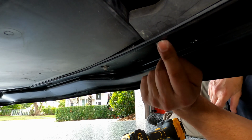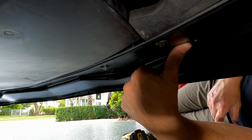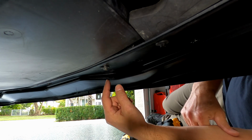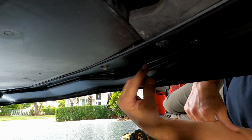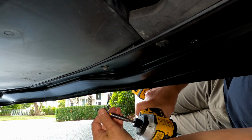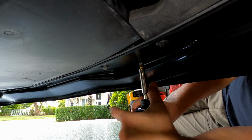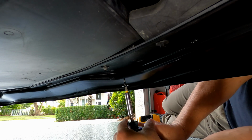Alright guys, so some of these have a little nut behind it that goes on these plastics, but these in the front don't. So this is where I think some of the rivets used to go in the prior, and the holes are a little bit big, so you might have to drill them a little bit to the side, depending if you had one or not before. I don't remember. If it's your first time putting it on, it should work. In my case, it looks like it lands in the same spots, and the holes are already kind of sliding, since it's on the plastic, so you might have to drill next to it. Like this one here is kind of sliding. That's where I had my other ones before. This one too, so I might have to do a little something here in the middle.